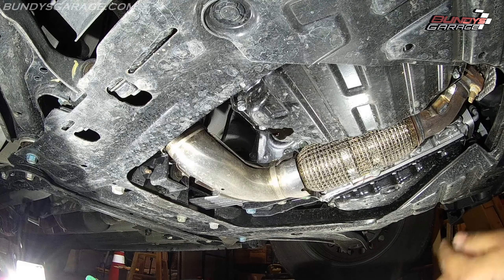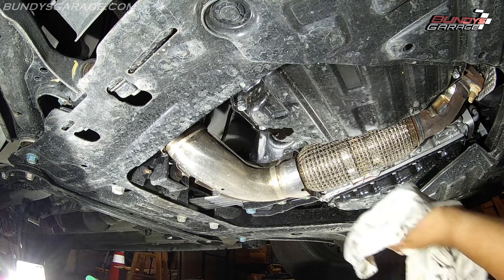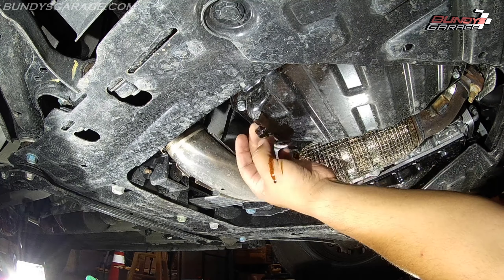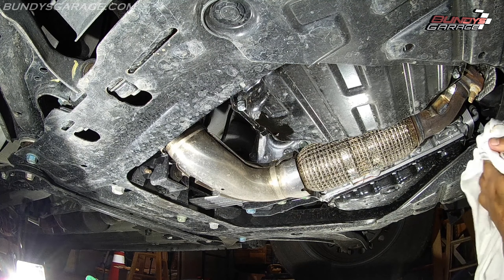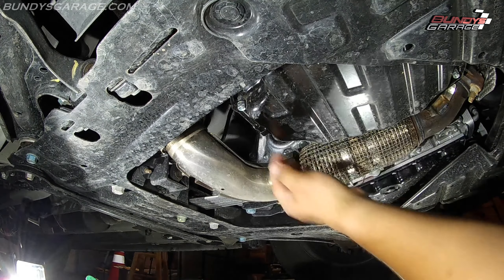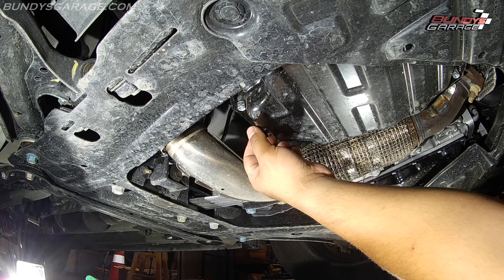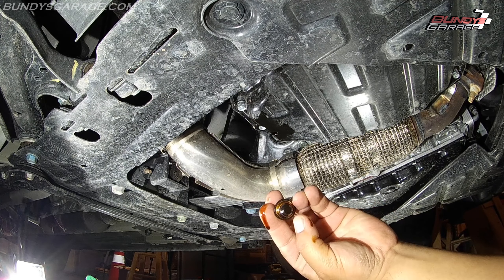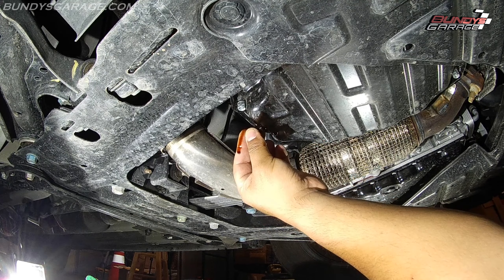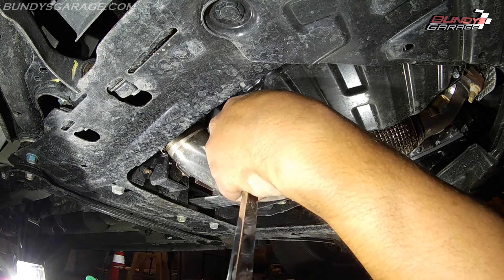Okay, it's been draining for about 20 minutes now — that's good enough, though I'd let it drain overnight if I had more time. Guide the drain bolt in and don't cross-thread it. There is a copper washer — make sure that is in place when you put the bolt back in, as it helps prevent oil leaks. Now we'll snug that up, then move over to the oil filter going towards the driver's side.